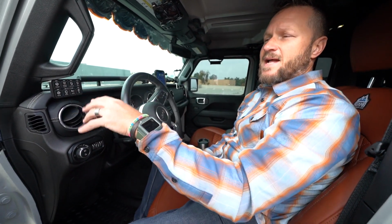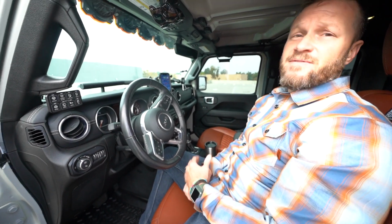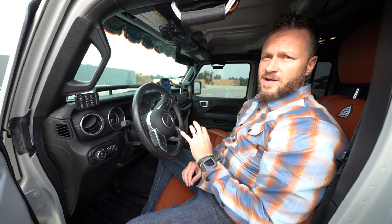They have a couple of different layouts. You can have a bigger panel, or you can run dual panels, which we do in some vehicles if you have a lot of switches. Here you can see we have the roof lights, the A-pillar, the horn, air, front and rear lockers, rack lights, and then the underglow for the rock lights.